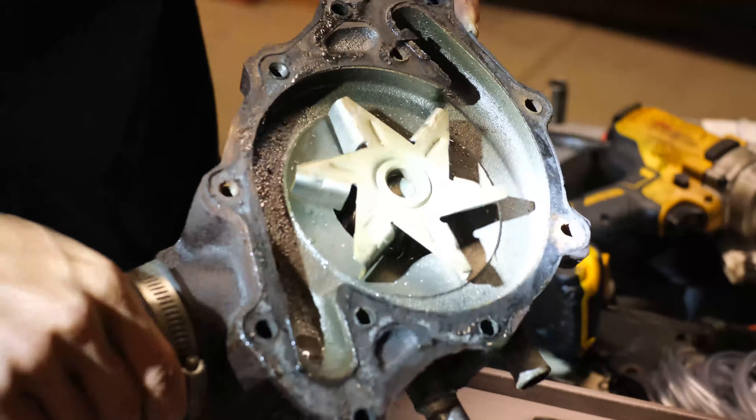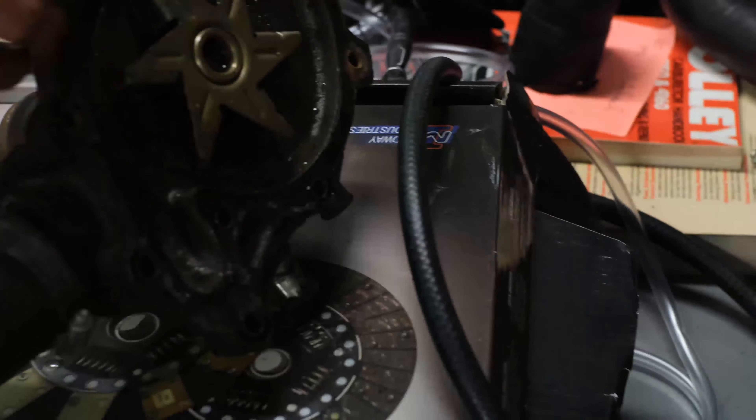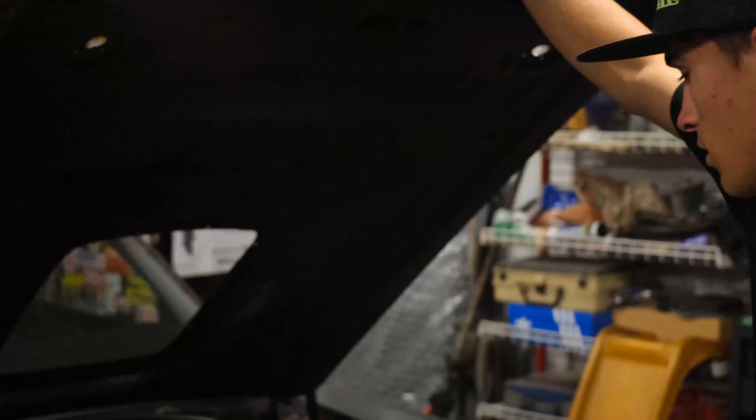It's not a counterclockwise one on a clockwise system. You can tell it's been replaced too because that backing plate — it just smells burnt, yeah, that's weird. His dad was saying it might have been the bearing got hot and cooked, but those two smells don't go together. And if the bearing got hot we would have heard something, and you can spin that thing — it's fine. I still think it's a hairline crack that's only happening under compression or under the power stroke. It doesn't even have to be a head gasket — it could just be a hairline crack in the head itself.